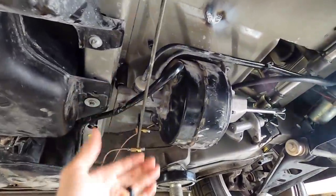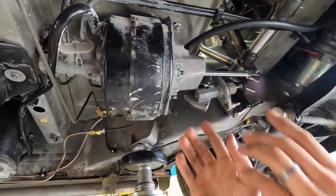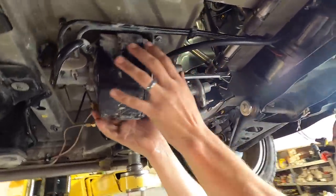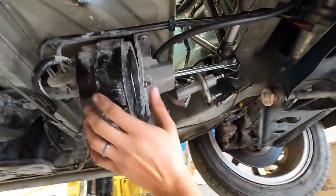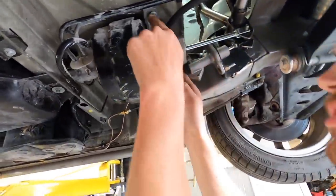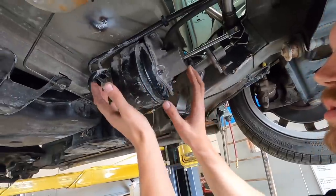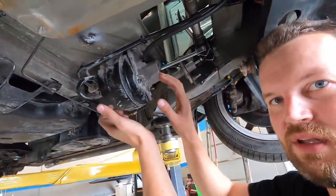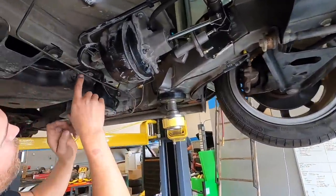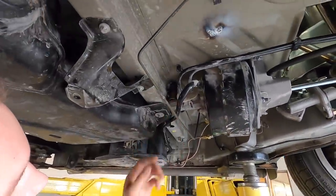So you had to move over the reservoir or no? So this booster here is odd. It's like slotted, so I was able to actually take it and kind of rotate it. Okay. So these kind of stayed and this guy moved. Well, you know, it's weird. There's only two mounting tabs on it, so this whole thing was just like articulating almost. Really? Yeah, it was pretty bogus. So what I did is I just welded in just quickly, just a little spacer here.